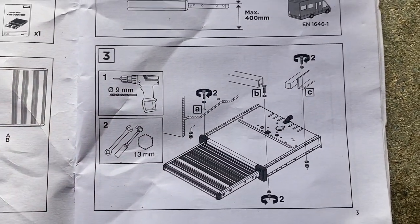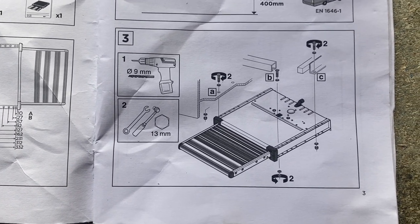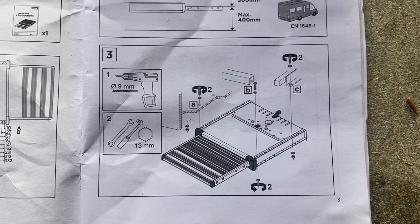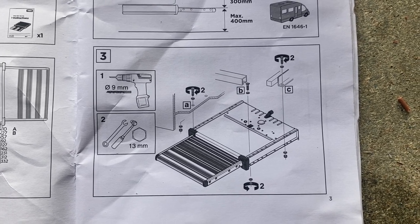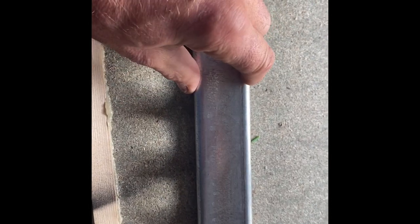What I'm going to do is show you what I've used — stuff essentially lying around in the garden — and we'll see if I can make this fit. I haven't tried it yet, so we're going to have a go. In an attempt to get this step level, I've realised that if I bolt this unistrut to the correct place on the underside of the van, the difference in height between the chassis member and the sill is approximately that, plus the depth of the unistrut.